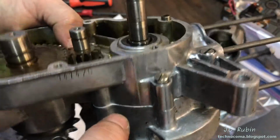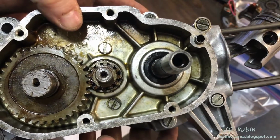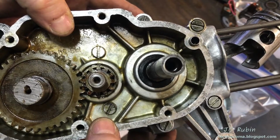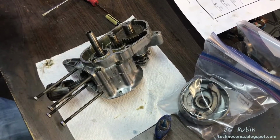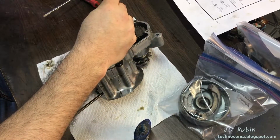There's one more thing I want to do now that this is done, and that is to remove each screw one at a time, add the blue Loctite to it, put the screws back in, and then do the final torquing. All the screws have Loctite in them now. The book provides no specification. I'll use my own judgment.